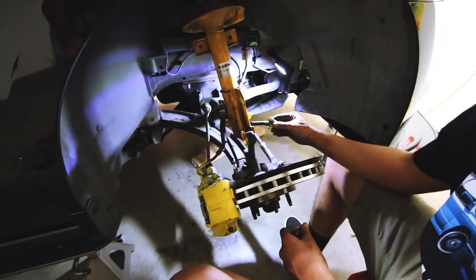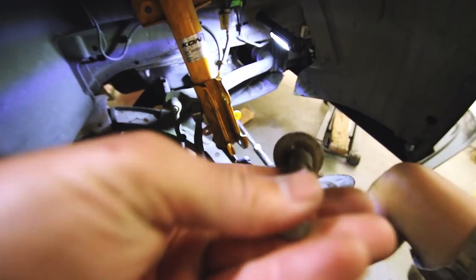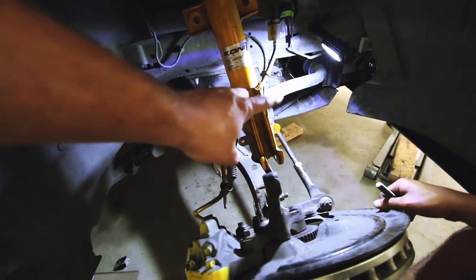We just finally got this off. It took way longer than expected — not 30 minutes like I thought at all. It's because of these eccentric camber bolts. As you can see, there's a lobe on there, kind of like a camshaft. This lobe got stuck on the inner strut. It takes a lot of finessing and a big hammer — make sure you take off the top one first to allow it to wiggle, or else it may never line up. This was extremely frustrating. Sabir even went home, but John stuck around and actually got both of them out. Now we're moving on to the caster camber plates. If we have issues putting that bolt back on, I'll just order the stock factory Ford bolt, since I'll have camber adjustment with the plates and won't need those camber bolts — which are kind of a band-aid fix for camber.